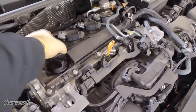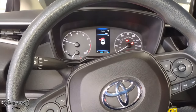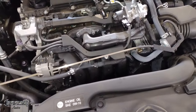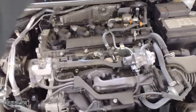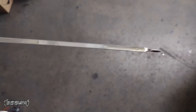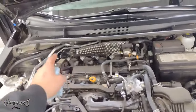Mine was pretty close, so I'm going to start the engine and recheck. The reason I do this is because it'll push oil into the new oil filter and all around the engine. Start the engine, let it run about a minute, then let the oil return back to the oil pan. Pull the dipstick out, wipe it off, put it back in, then pull it back out — that gives you a clear reading. New oil can be hard to see because it's clear, but as you can see it's right at that second dot. That's perfect. Stick with 0w16 oil viscosity.